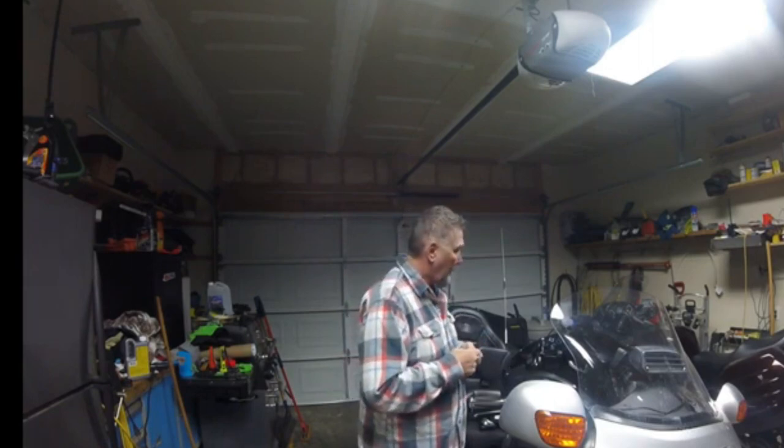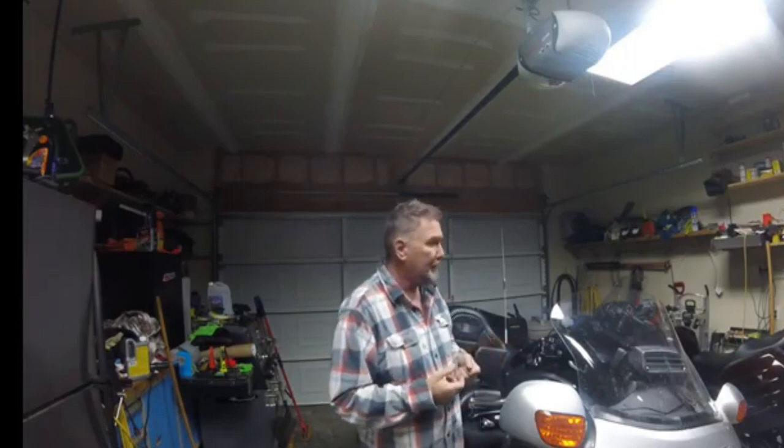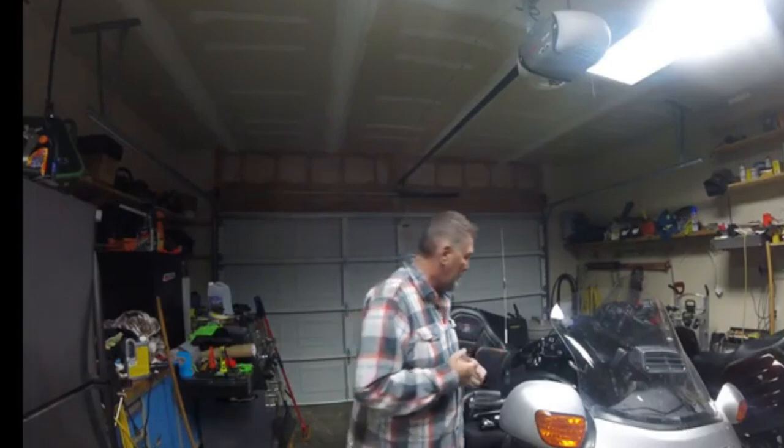I used a Q3 Cardo for the test. What I found was that it was very garbled and echoey. After doing a little bit of research, I found out that I should have an attenuator in there. Did a little investigation online, found a couple, and ordered two different ones. I ordered an inline one that just has the 3.5 plug, female and male end, with the attenuator built in. I also bought one that I believe is just a volume knob. They call it an attenuator. Maybe there's some circuitry inside.